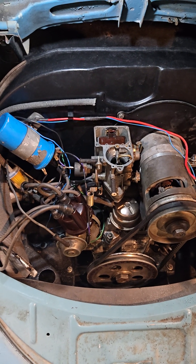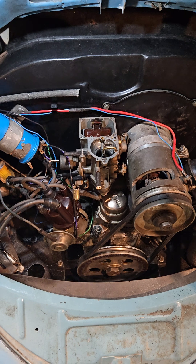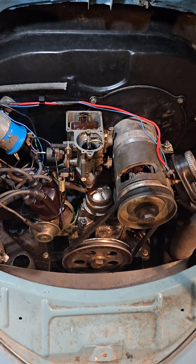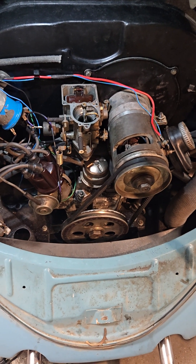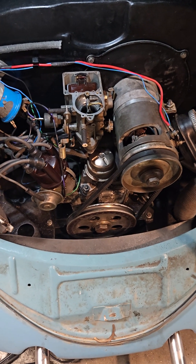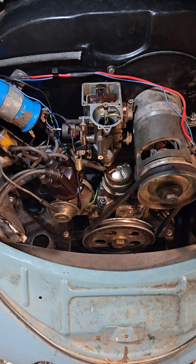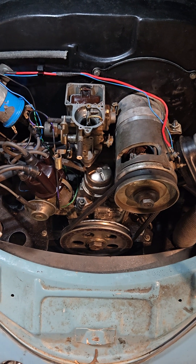One caveat: if you're having a lot of running problems, sometimes it's not the carburetor at all. Sometimes the valve springs are weak. I've seen one engine where they were 20 to 30 pounds below spec. There's a tool that lets you check them without removing the head — you do it while the engine is in the car. Most guys don't check valve springs; they just put them back on the engine. But it's good to know: they're supposed to be around 120 to 135 pounds, and on that particular car they were all around 90 pounds. Also, everybody checks compression and thinks it's fine, but you should always do a leak-down test.